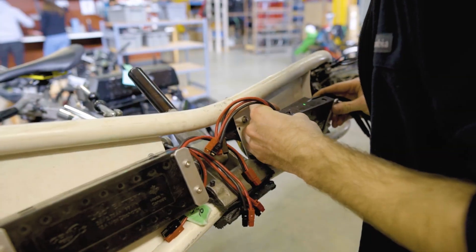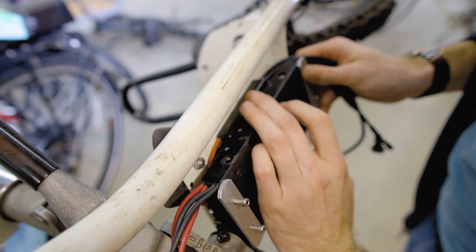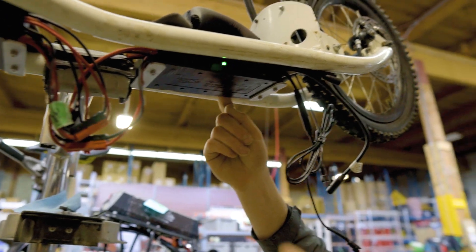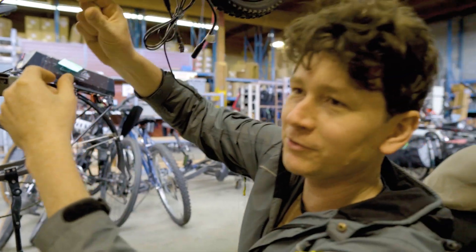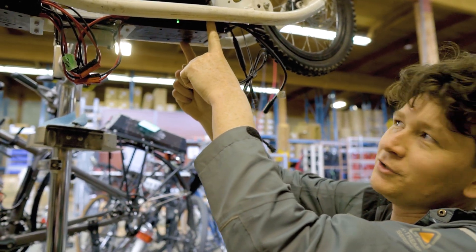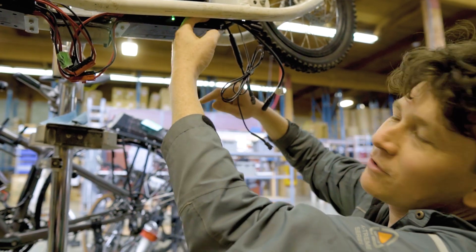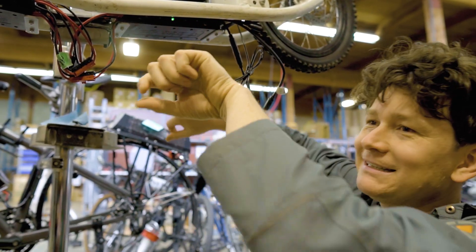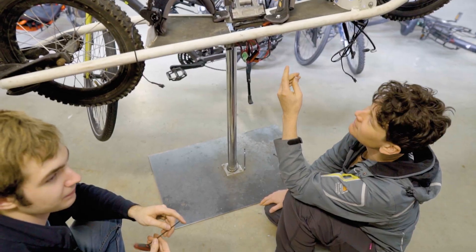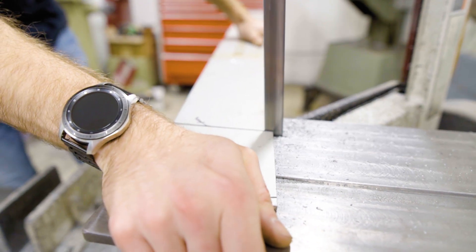With the Baserunner, we're going to mount it against the metal plate so the heat dissipates from the heat sink on the bottom. We're going to put a LIGO on top so everything's held together nicely. Later on we might mount a plate between the Baserunner and the LIGO to keep the LIGO from flexing, but our first tests suggest it won't be necessary. The Baserunner controller should be bolted to at least an eighth-inch — maybe five-millimeter — thick aluminum plate that extends to the sides of the two tubes, because this strip and this strip have airflow passing by them at the edges. That way there's a heat dissipation path going sideways to the area with airflow, allowing the controller to run much longer before hitting thermal rollback.